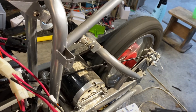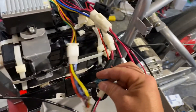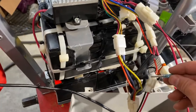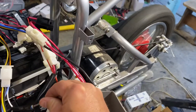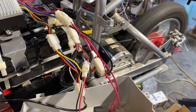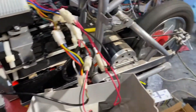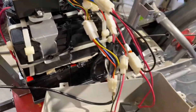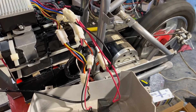My kid's not quite ready for the speed, but I don't have to build the bike a bunch of times. That's full throttle there, even though it's not — I can just dial full throttle up and down. I make these and I sell them. Anyway, that's how you make it 48-volt and put a potentiometer to slow it down and speed it up. Sorry about the bad video.